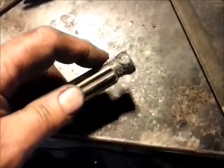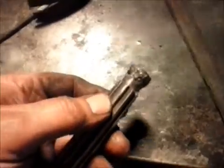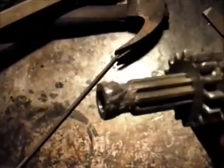Here's the shaft - this end was about half this size and I've added two washers to hold the corner of the shaft. I'm going to grind this down. I rough ground it on the bench grinder. This is the spline shaft that makes the shifts in the gears - it moves back and forth to get the different combinations. Here's the input side, and I added some length that I'm going to grind down on the bench grinder.